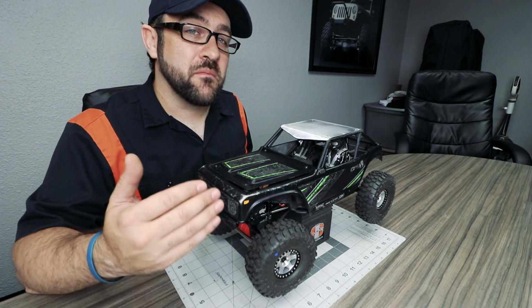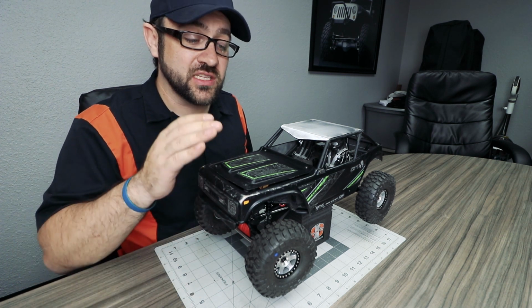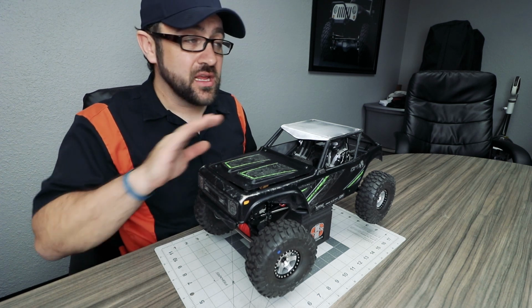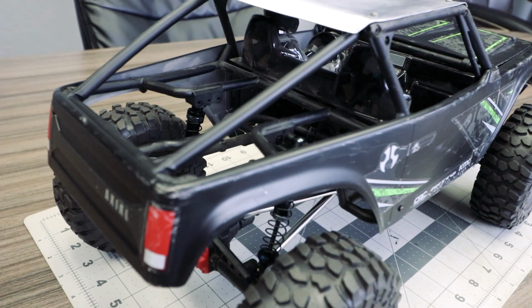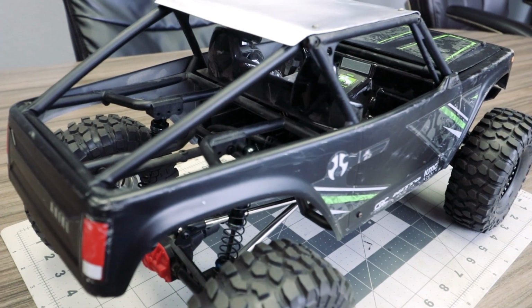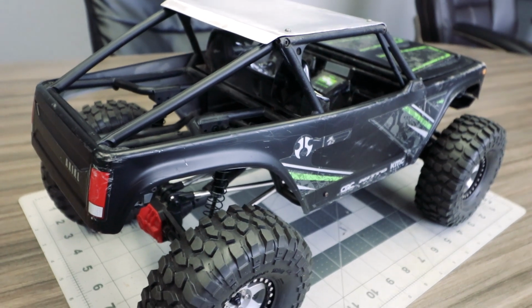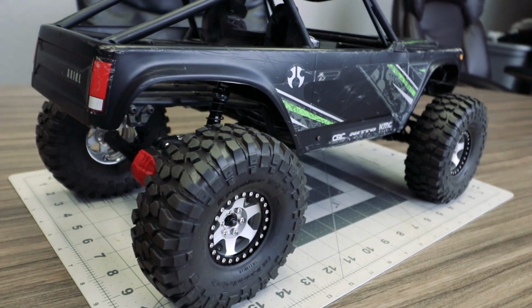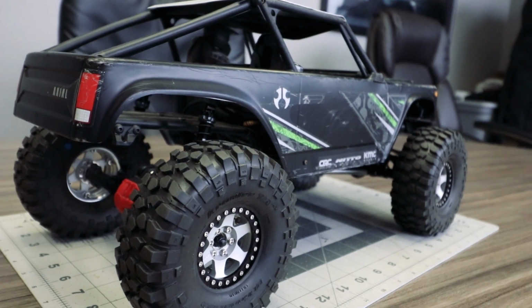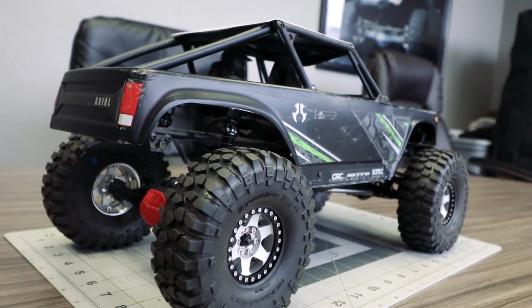This wants to try and modulate that itself so that whatever speed you're pulling the trigger is what speed the tires are always going, no matter what the load is. Therefore, if you get bound up quickly, it's going to feed in a bunch of power itself quickly to try and pop this thing up and keep it moving. And that can be a little bit different feeling. Where that is supposed to be of a benefit though, specifically, is controlling this in a downhill driving situation.